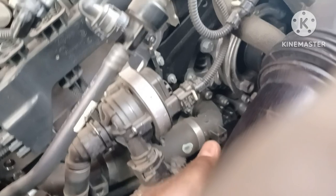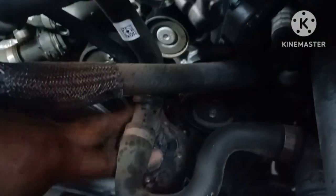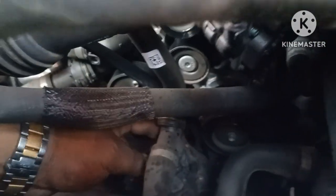Here's the belt. I could take the whole belt back off — just make sure you remember how to get it on there because you've got to reroute it. It's routed all the way up around the alternator, around the AC compressor. Now we're kind of stuck because we've got to get it from around this big bracket right here — we've got to unhook this and get that belt off.